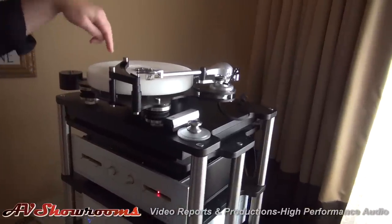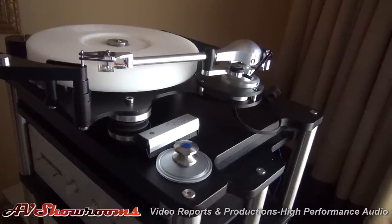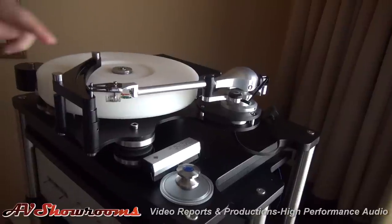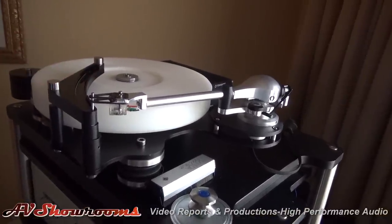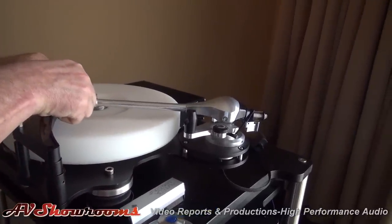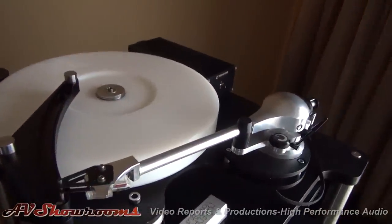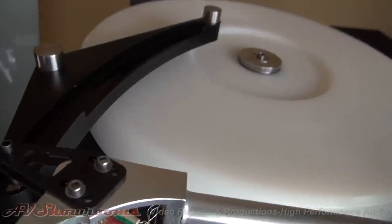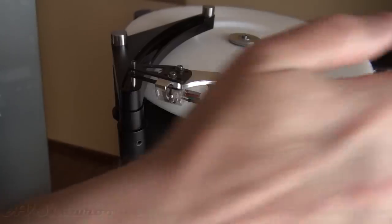We have a quick explanation of the damping mechanism. It swings out to put your record on, then swings over when you go to play the record. There's an extension on the head shell with a paddle that rides in a silicone bath as it goes across the record. In that way, it is damping all the vibration created by the vibrating of the cantilever, removing it before it can go down the arm.